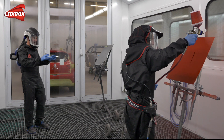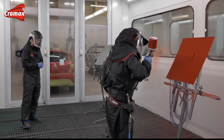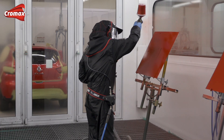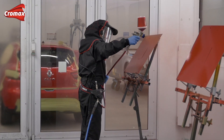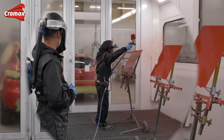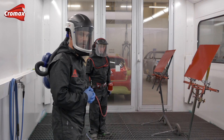So, we have three panels here. We apply the base coat on all three panels for hiding, and we do this because we want to ensure that we have identical applications later on also on the car. That's the reason why we have larger panels. You can also use an old car panel to do that. Okay, the base coat application is finished. We flash it off now and come back with the clear once they are dry.